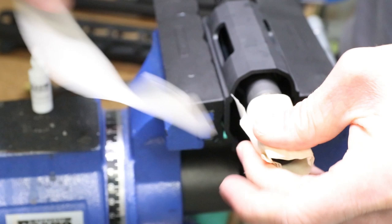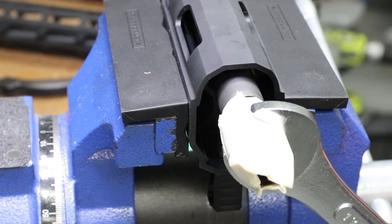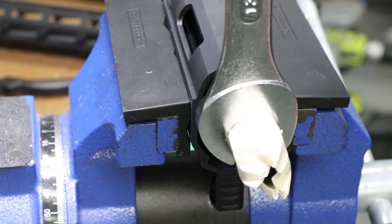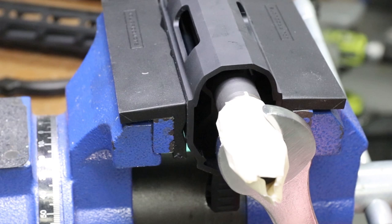We're good - kind of compress it down. It's nice and hand tight. Now we just grab a wrench. So now we're going to start our rotations - 13/16 fits on there perfectly. With this crush washer, you'll feel it start to bind eventually. It's starting to bind a little bit. You just back it off a hair - you're just relieving the stress there on the crush washer. That's a good practice as you feel it get really tight - back off just a hair, kind of release some of that tension.